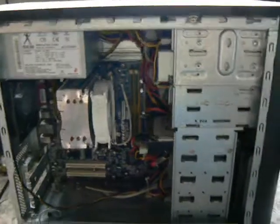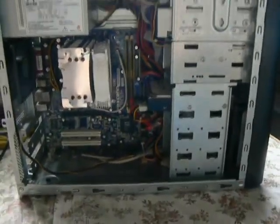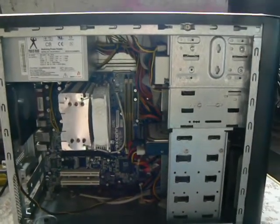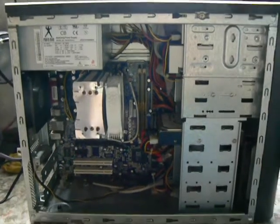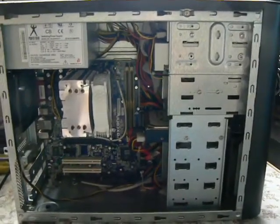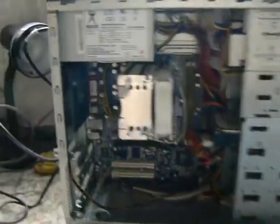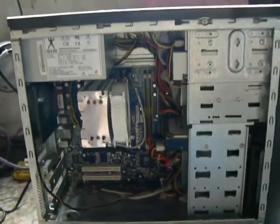It should work well also because this is going to go in a cupboard — I need the on/off button to be at the bottom so it's reachable, which it is in this case. Overall I think this is going to be a better server than the one we've got. What I've got to do now is get the operating system loaded, get it all set up, and configure the various software packages I'm going to need. I'm probably going to use Webmin as a web interface. I've been playing about with Ubuntu Server in a virtual machine, so you can use Webmin, or an SSH client like PuTTY — which means you can use it as if you're actually in the system itself, so you don't need a monitor on the system once that's installed. There are lots of ways of accessing it.